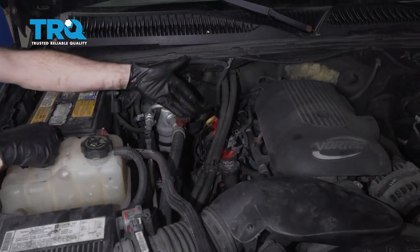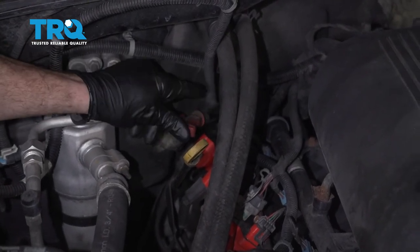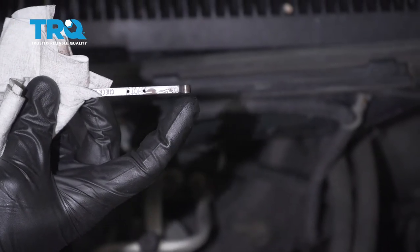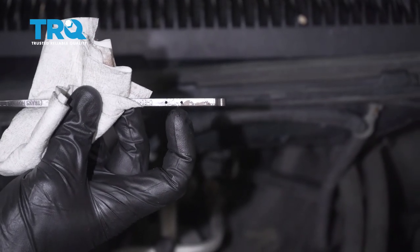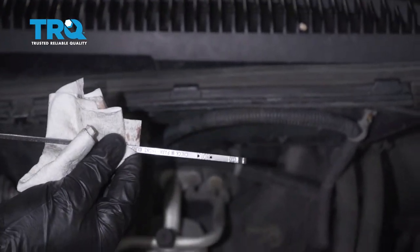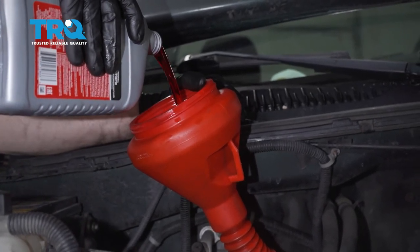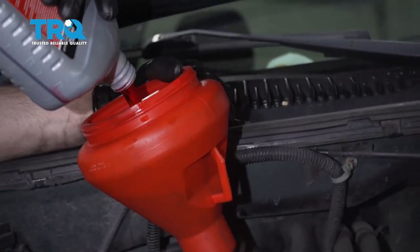I checked for leaks — I don't have anything. The engine's been running for a little while and it's up to running temperature. I'm going to come right down here, put this in, give it a little twist, let it sit for a second, then carefully lift it up and out of there and inspect the transmission fluid level. Looking at this, it looks as though I'm all the way down in this area here, which essentially tells me I need to keep adding until my fluid makes its way up into the safe zone in between these two hatches. I'll just add until it's in that position, close it up, and take it for a road test. To fill this, it's going to be easiest using a clean flexible funnel. I'm going to add approximately one quart in my application of the manufacturer's specified fluid, then start it up, run it for a little bit longer, and recheck that fluid level.